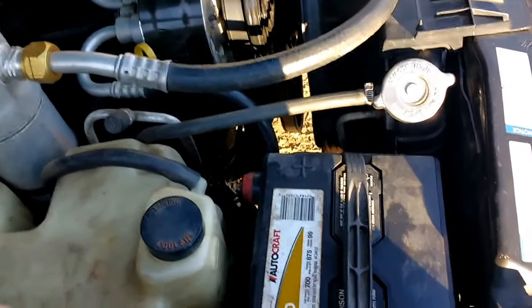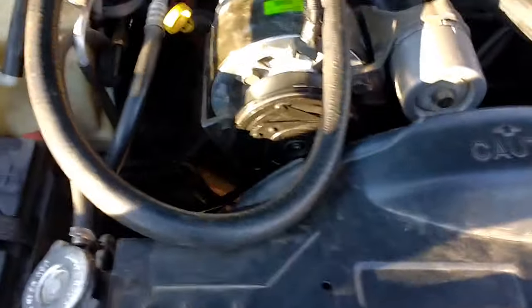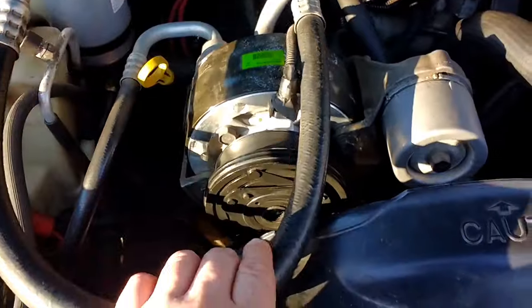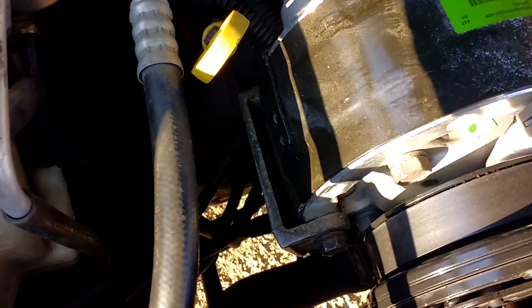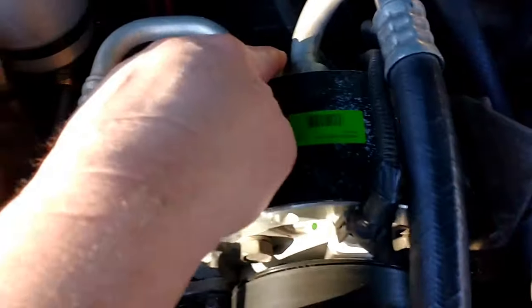They cost around $70. The thermostat is typically around $10, depending on where you get it. For all of you switching out this compressor — it took me about four hours. Because you've got this bracket, the way it sits there, it holds the front and back of the compressor. After you get the four bolts out and all these nuts out, which are 9/16ths and 5/8ths.